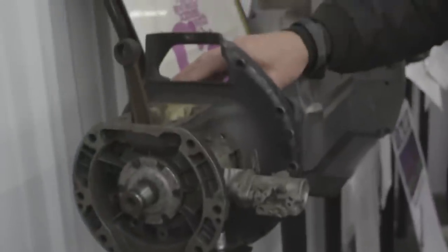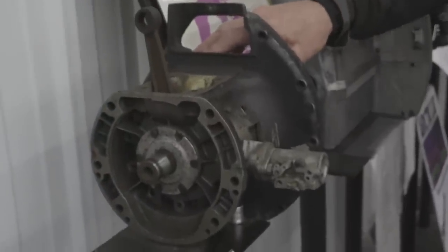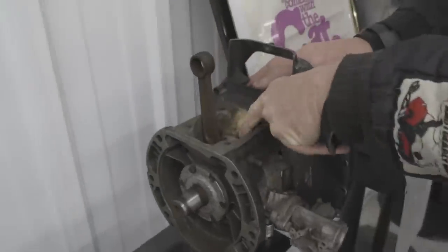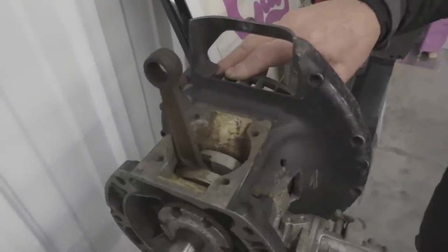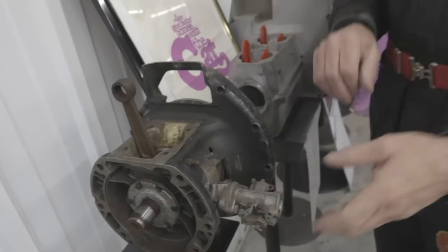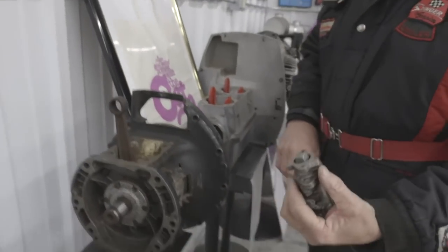As we went along, we were trying to make more horsepower. This is a single cylinder Hirth. What we did is we epoxied the transfers, filled the transfers in, and then we could see here the aluminum, we full circled the crankshaft so that we could get more compression in the crankcase, push it up into the fuel, into the cylinder.